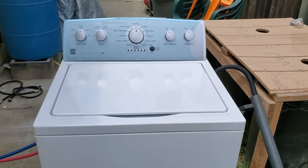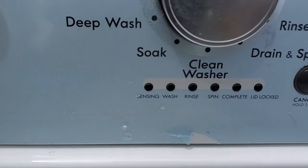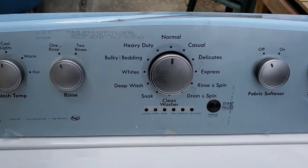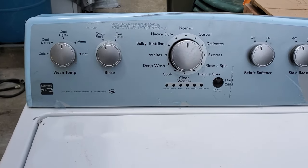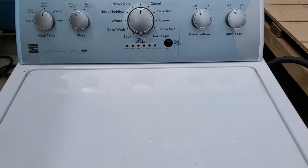It's been a few minutes. I can hear it washing, and sure enough, it's progressed to the wash cycle — that pretty much fixed it. It was an easy fix. Hopefully this video shows you how to get to the main problem that causes this washer to be stuck in the sensing mode, which is the failed valves. I think my daughter Sara liked it as well. If you liked that too, make sure you hit the thumbs up, and hopefully we saved you some money. Stick around for more DIY videos.